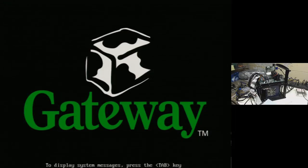This may take a while to load again, like before, so I'm gonna cut the video and hopefully this will actually boot. Okay, so it wasn't booting off of floppy for some reason, but I do have a CD that has DOS on it. So I actually attached a CD-ROM drive here. So we're gonna try to boot off of a CD and see what happens. I mean, why not, right? All right, so I have it plugged in with a CD-ROM drive here, but it doesn't seem to be booting anymore. Not sure why.